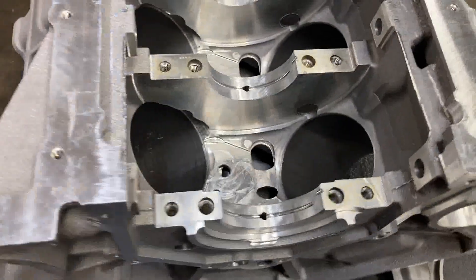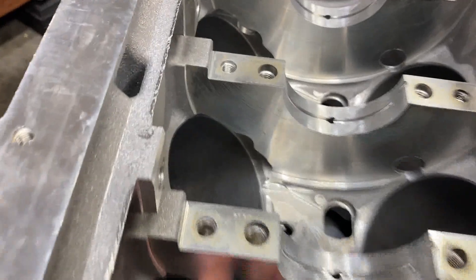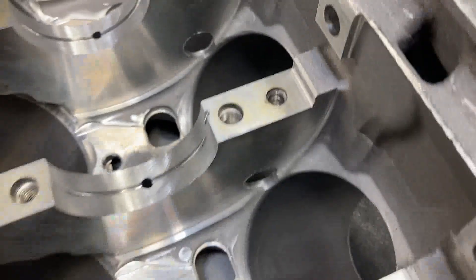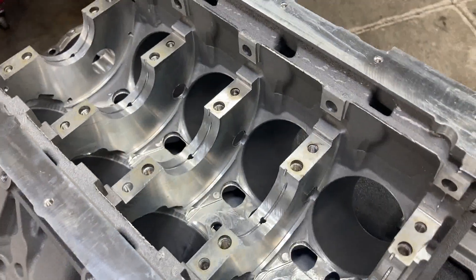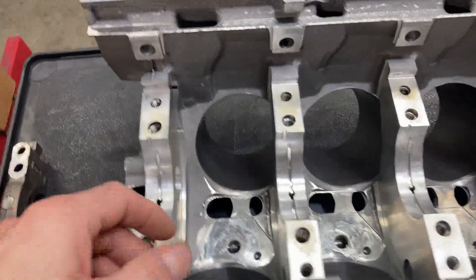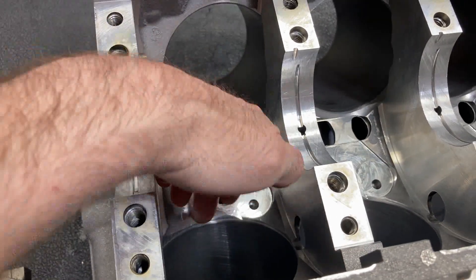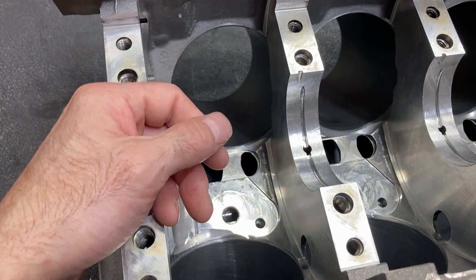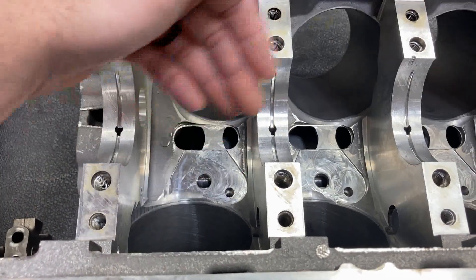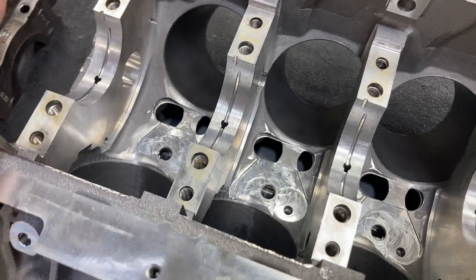Here are the cylinder vent holes — they go all the way through on each side. You can see my fingers sticking through here and through here. So that aids in not only block ventilation but cylinder ventilation. If you have a hole near the cylinder, each cylinder can scavenge off of the next one — you can pull the air from around one piston and give it a little bit of help, since there's less drag associated with that cylinder.